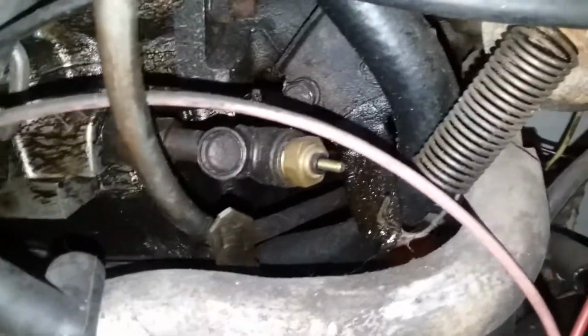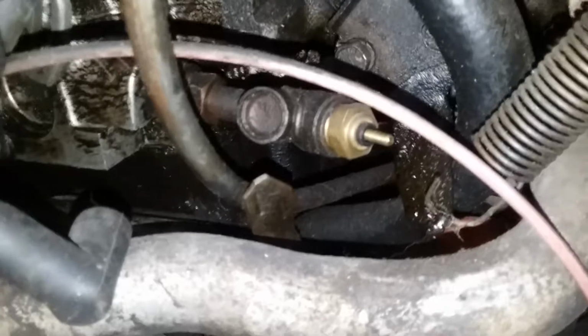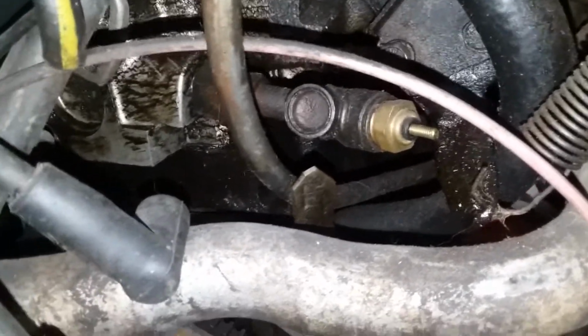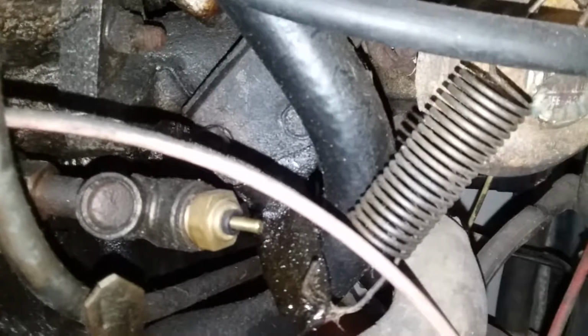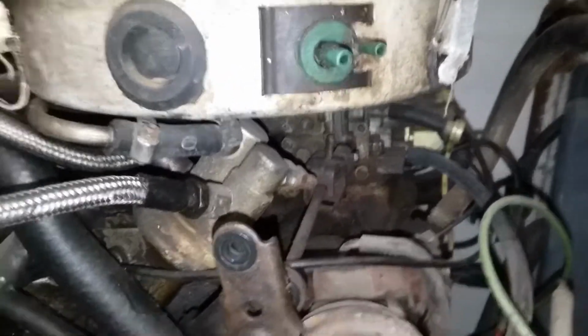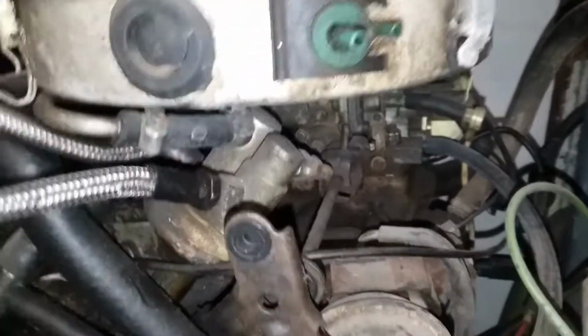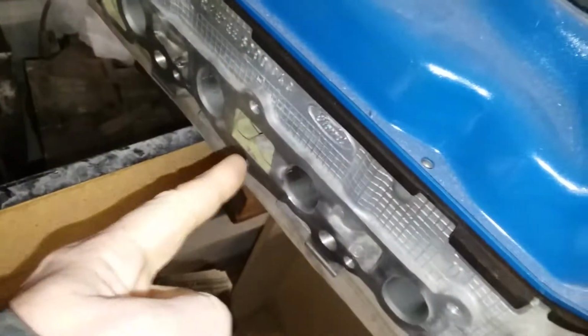That's really all it does. You can remove that hard metal line and cap it off if your intake manifold already has a coolant line, like you see there, that has the two metal hose clamps. It does the same thing. This is probably just a little bit more effective. It would get the hot coolant out of the head faster than stuffing it through the intake manifold first. But keep in mind, this is only the carbureted intake manifold. I don't believe any of the other intake manifolds are like this, where the coolant travels within the manifold to keep the intake charge warm, except in the CFIs.